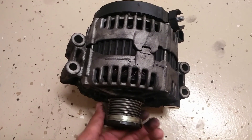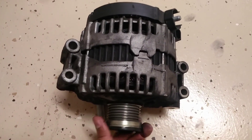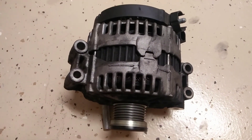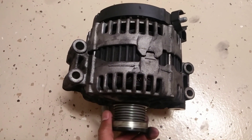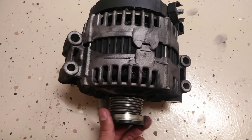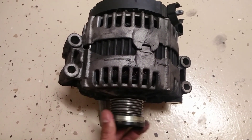You have to remove the idler pulley and transplant it to the newer one. This is the issue - check out the noise. It doesn't move evenly. The first half it moves okay, but the second half it's as though something is getting stuck.